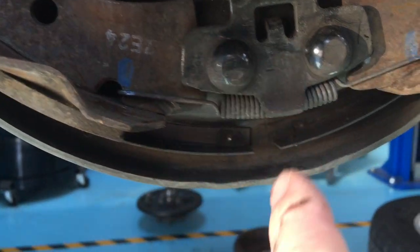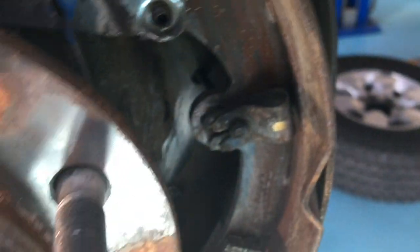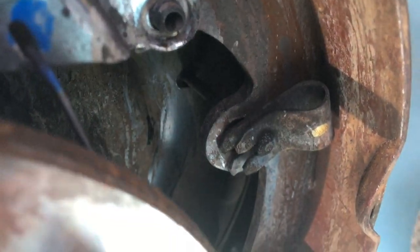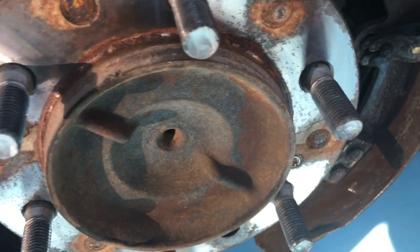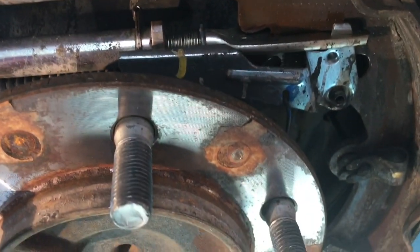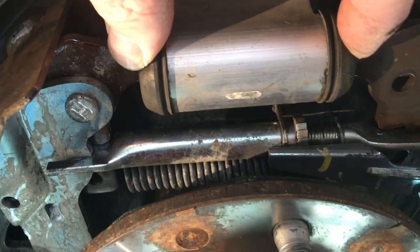I would carefully grab and grip that spring right there and pull, stretching the spring that way to unhook it — that comes off. Then next I would remove this clip here, probably using side cutters as well. Grab it around here so the tip gets inside that clip, spin it around — pop this clip off. Then there's not a lot holding things because you've got the clips allowing movement and one spring already off.